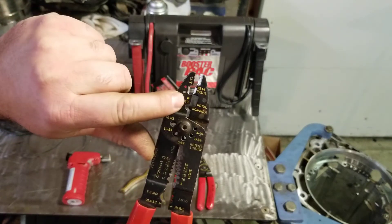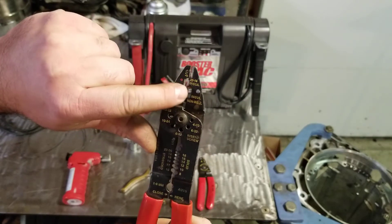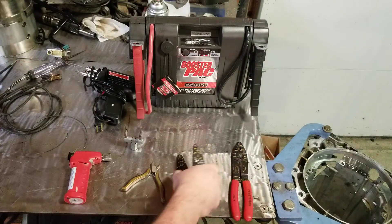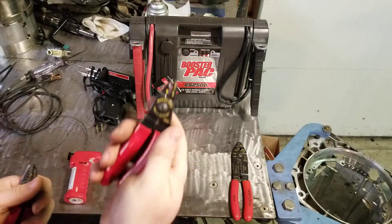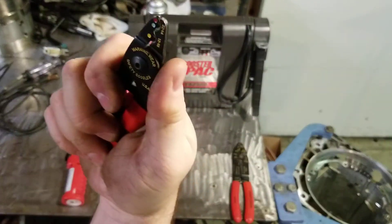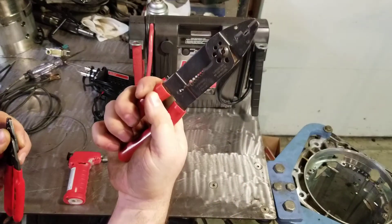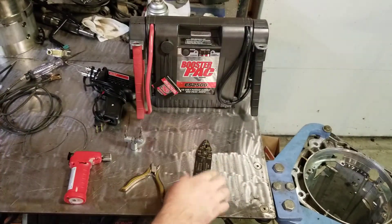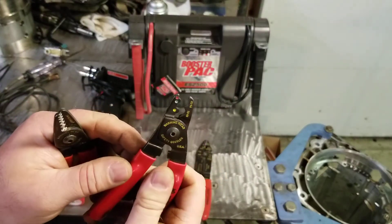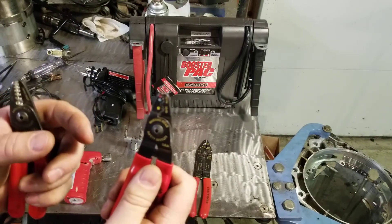If they have plastic on them, like the ones you see when you buy at most of the parts stores, they have yellow, red, and blue — they get crimped in these flat parts. This one has cutters. The ones I like to use are these smaller ones. They get into a lot tighter spots. If I'm working in a dash, I can get this whole thing in there a lot easier. This crimper only works for non-insulated terminals, so if I'm doing terminals that have coatings or plastic on them, I would have to use the other crimpers.